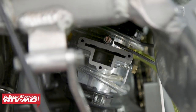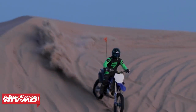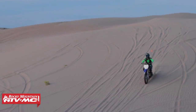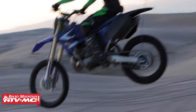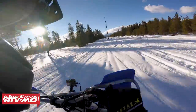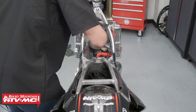Another thing that is possible to adjust on this carburetor is the power jet, adjusted by the screw right on top. Stock, it's going to be anywhere from three-quarter to one-and-a-quarter turns out, and you never want to run the bike with it fully closed — most of the time it's going to be less than one-and-a-half turns out. Lectron also recommends: if you'll be running in sand dunes or on a snow bike where you're at wide-open throttle all the time, turn this screw one-eighth to a quarter turn counterclockwise to richen it up and help the bike run a little cooler. Keep in mind you're never going to be more than two turns out on this adjustment.